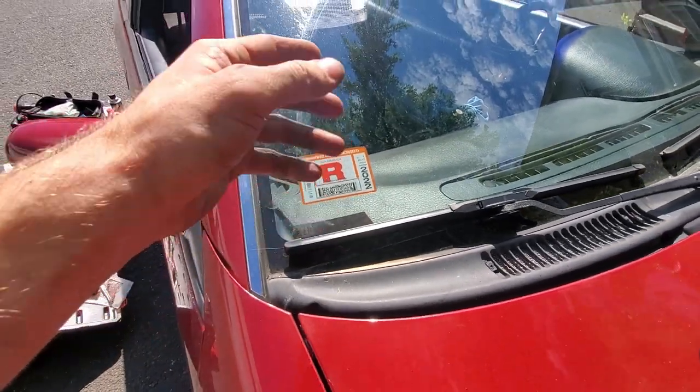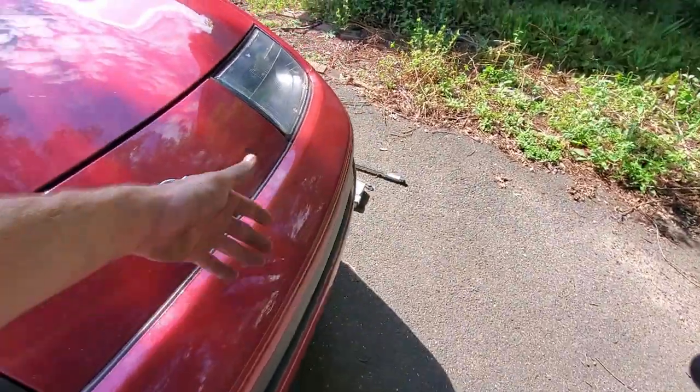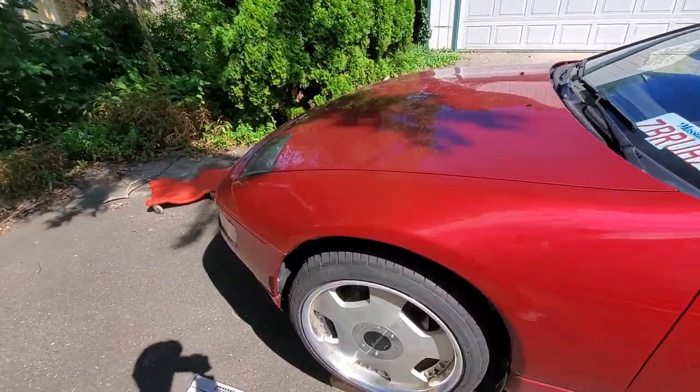That's not good. A red R means it's rejected for safety issues; a black R is just rejected for something minor like a headlight out or no license plate. But a red R is not good. After looking at my report, the guy that did my inspection said: 'Listen man, you have a gorgeous car, it is immaculate, but the front end has some play' — and by play he meant a lot of play. Thinking back, when I first got the car in 2016 I never asked if anything was done to the front end. The car is a '92 NA and it's almost 2022, so it's almost 30 years old. I'm pretty sure the ball joints, the inners and the outers, have never been changed. So basically what we're going to get into today is swapping the inner and outer tie rods and the lower ball joints on the front end of a Z32.